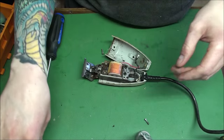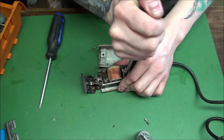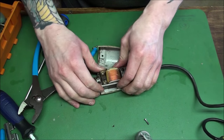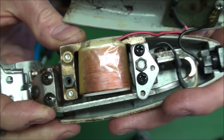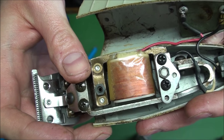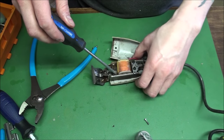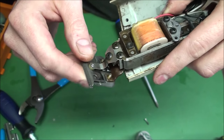So let's just begin and I'll try to show you the best I can the way I figure it out. I go ahead and loosen these and then you can adjust this. I think it's best at about a quarter inch to start out with and then go from there. Remember this has got to be adjusted right — if it's too tight then you're not gonna be able to cut. This has to have about one to two pounds of pressure on this blade, that's it.